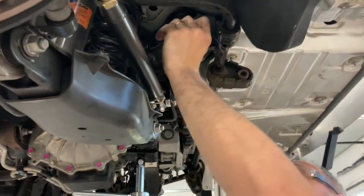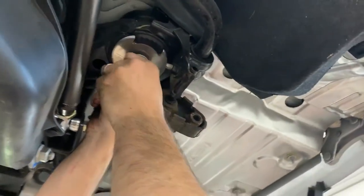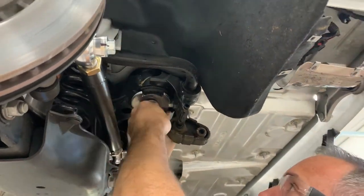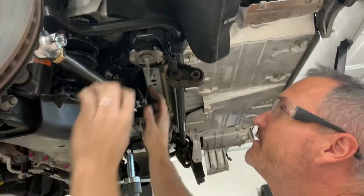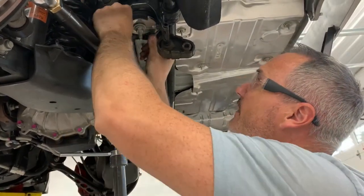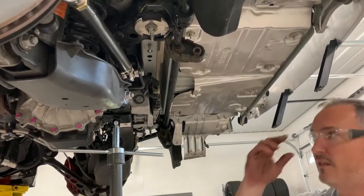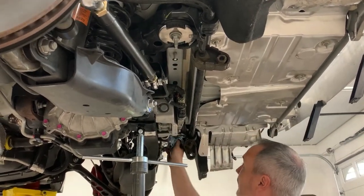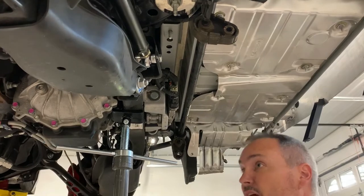This side. Already had those pins in position. Install this. And I'm reusing the factory bolts. Some people won't because they are torqued to yield or torqued to an angle from the factory. Seeing as how this component is not a moving component like in the suspension, I'm reusing them. You don't have to. I think GM recommends you replace them, but I'm going to reuse them and torque them back to factory specifications, and the BMR instructions have torquing values for those. So torque them to that, and then we'll get our other braces installed, and we'll get everything torqued, and then should be good to go.